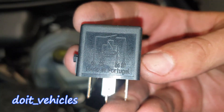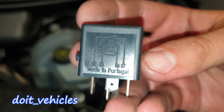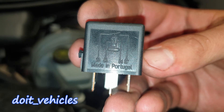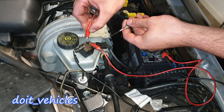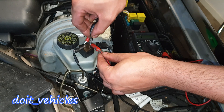In this situation, just take out the relay and test it. It's quite a simple relay. On the relay itself there's a small wiring diagram which shows us that pins 85 and 86 are for the electromagnet or the switch. Also, pins 30 and 87 are on the positive side of the ABS pump, which means that once we close that circuit the pump should be activated.